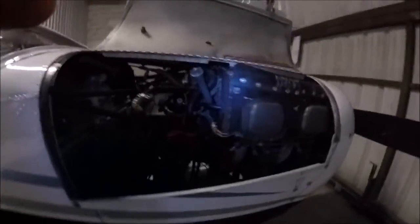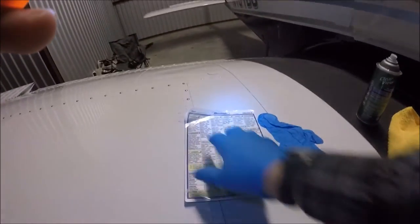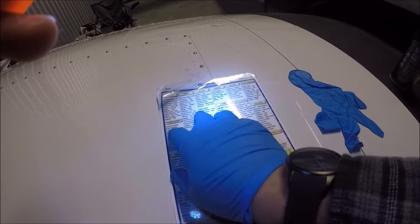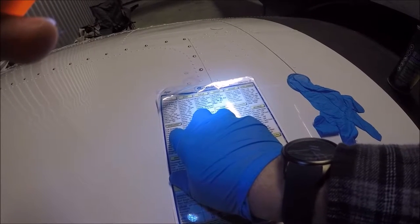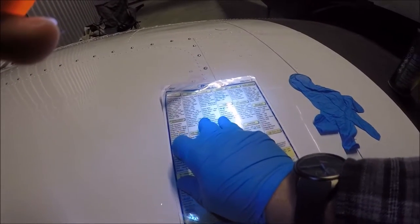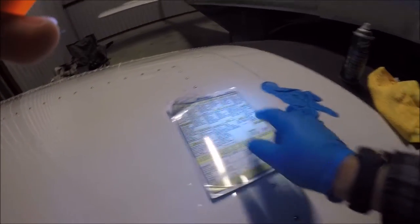So now we are back where we started. The next thing I do is put the checklist down and make a mental run of everything I've just checked. Fuel quantity and quality is good — cap, strains, vents, so on and so forth. The quality of the fuel is the next thing we're going to check; I always do that last because of the way I check it. Engine oil, belt — good, so on and so forth. Go through and make sure you've checked everything. If you've used your towel and taken your time to go through the complete aircraft, you should be good to go — you actually end up checking more things than are on the exterior summary list.